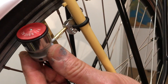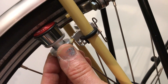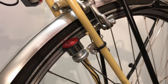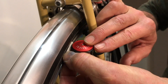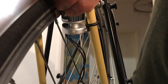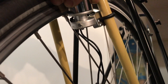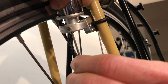The dynamo is mounted on the bracket. Now we take a spacer plate of 2 mm thickness and place it between the O-ring on the dynamo and the rim. We make sure that a small piece of the torsion spring will still peak out. In this position we can now tighten the grub screw.